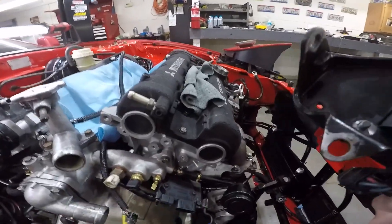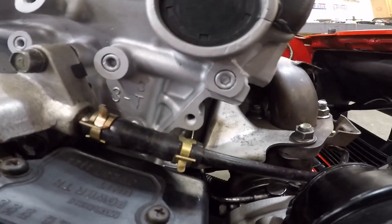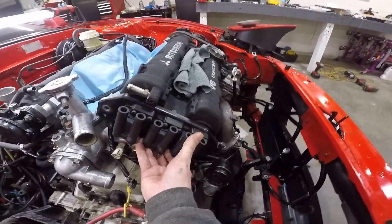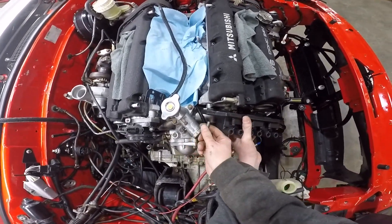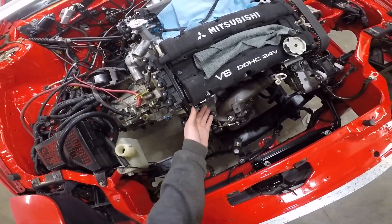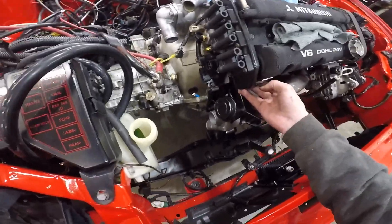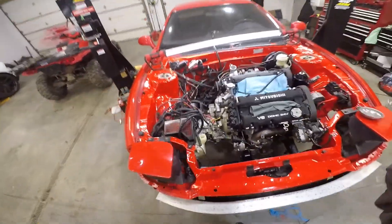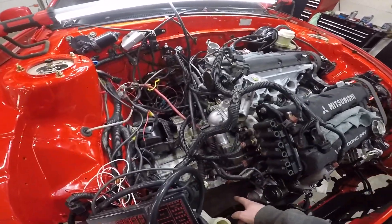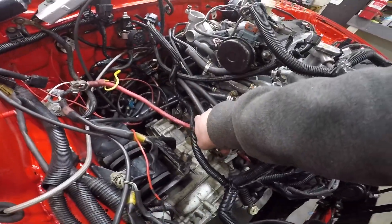Let's get this coil pack on. You gotta get a 10mm — you see that little hole right there? You gotta get it up there, slide it around that hose, and then get a long extension down under there. I'm going to put this one in first, get it snug to where you can still move it. Since I'm not running that bracket I gotta put like two washers in there. I'm not gonna be able to record the rest. Alright, I did everything over here — got my shift linkage hooked up, got my grounds hooked up, got my wiring harness all ran, got my slave cylinder hooked back up. Everything over here is pretty good.